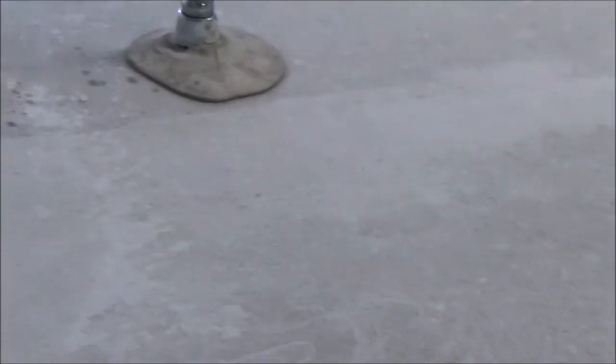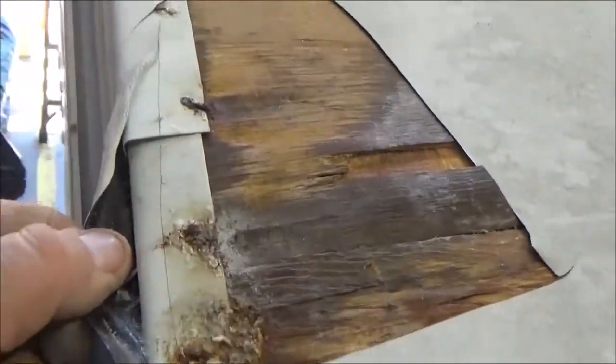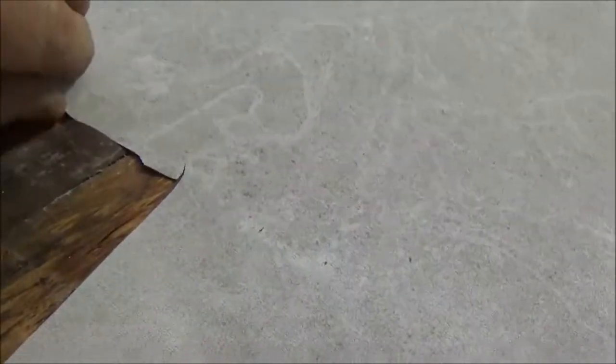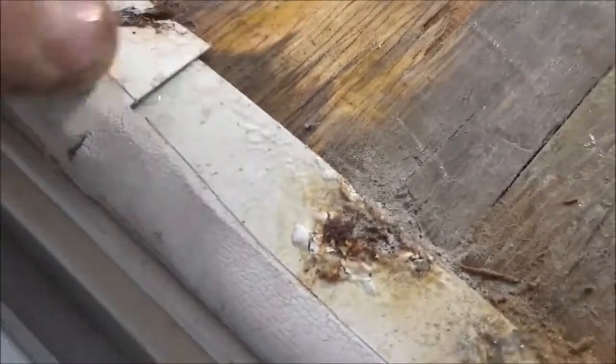Just to give you an idea — let's see what this is. That doesn't look good at all. We'll find out what that is when we take the roof off. Let's see what's causing that. There's some staples in there — that little protector piece they put on there didn't line up, that's what that is. You can see it had some leaking in here; we just thought this roof was good. Something's leaked there — you can see the stains, it's still wet. See how it's delaminated? That's delamination. Some rotting right there going on. You can see all these little holes right here — that is from this piece right here, that's what caused that little leak.